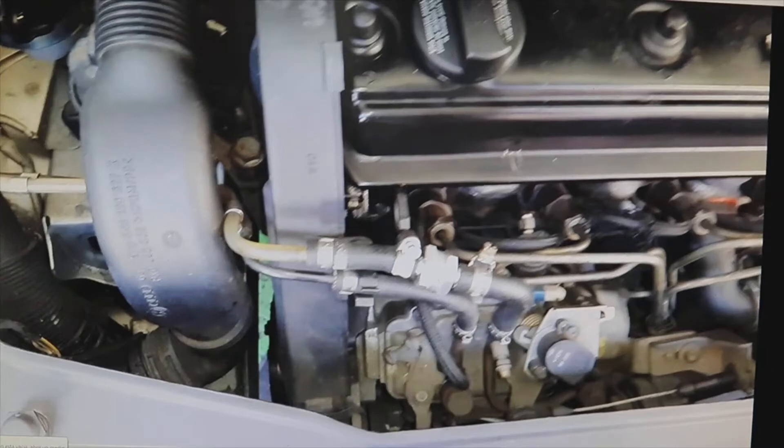Welcome to a new video from the parts channel. A while ago I made a video about the non-return valves, which are normally a temporary fix. This vehicle is a Volkswagen Polo — it already has its years and kilometers. We put it on precisely because it was difficult to start, because over time the gaskets that the injection pumps carry end up degrading, then air ends up entering and displacing the diesel, making the vehicle difficult to start.